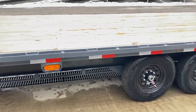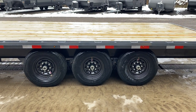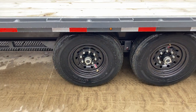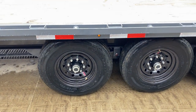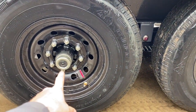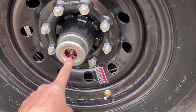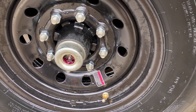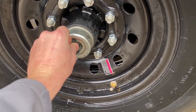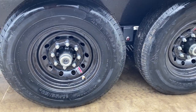Mid markers are standard equipment. The three axles are all 7k, with an eight-on-six-and-a-half lug pattern. It's got the black mod wheel with a 235/80R16 load range E 10-ply tire. It has the newer style forward-adjusting brakes and the newer easy-lube hub — behind the black cap there's a grease zerk. You can just give it grease until you see new grease come out, or take the whole cap assembly off, clean the old grease out, and repack with new.